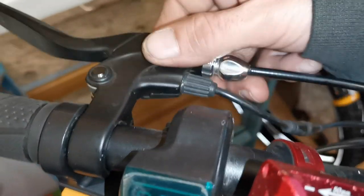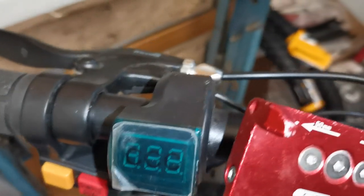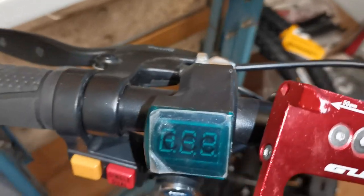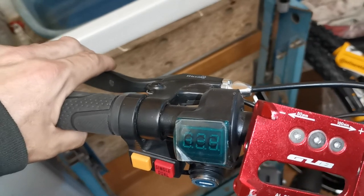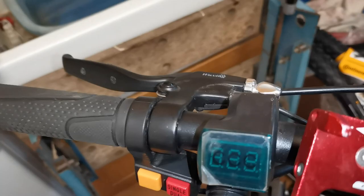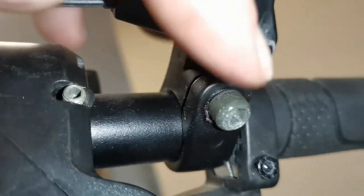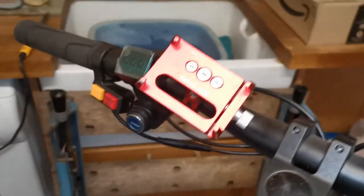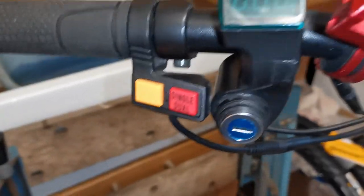After that you want to get this correct. I recommend just standing over your scooter, putting your hands on the handlebars and feeling it out. If it doesn't feel right, raise it up or lower it down however you choose, and then do the grub screw up. Just do that up and that's pretty much done. I haven't done that up yet but I'm just going to skip ahead so I don't waste your time.